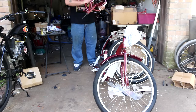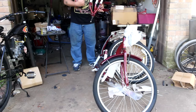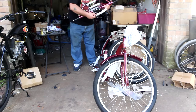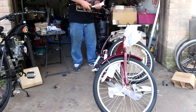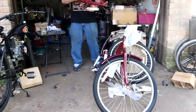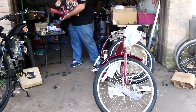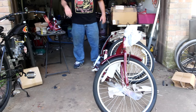Now then, we're going to put the rear end on the bike. You have the four screws on it that will hold the basket, so you want that up. So it's going to go on the bike like this here. You've got the one bar here that I'm grabbing. That's going to be like the bumper bar to protect your sprocket. That's going to go down. So basically you have the three bars here, one, two, three, that are going to go up. You've got the slots cut in these plates, which the studs will go into and mount it in place.